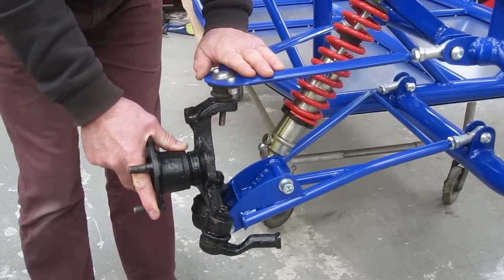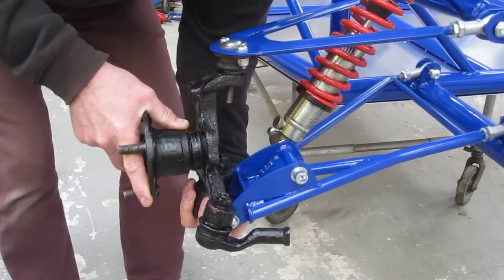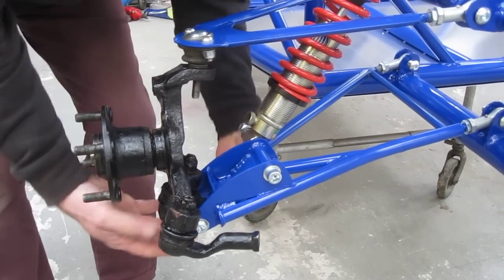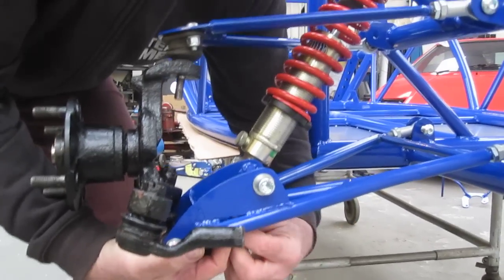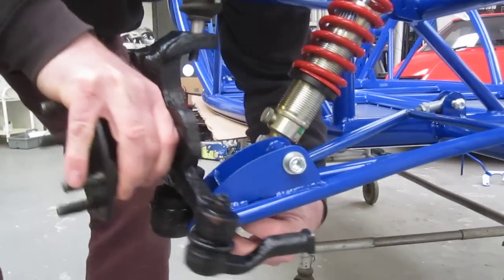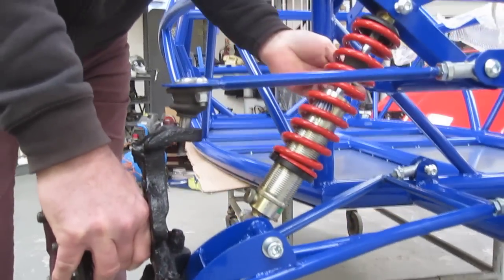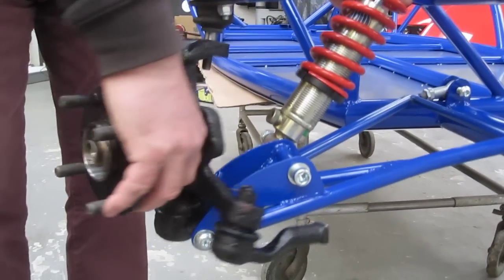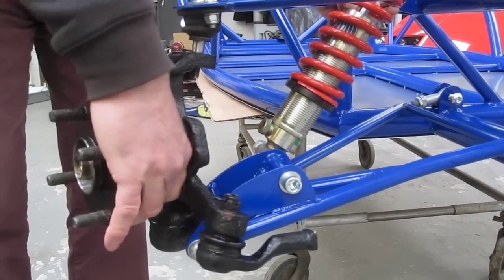In this particular car, it's quite easy to solve. All we've got to do is rotate the bottom ball joint assembly on the main pin. We'll put a couple of packing washers in the space there and bolt it up later. Just to prove the point, I'll put one washer in and load that into place like so. Then when we try to locate this wishbone at the top again into its proper place, it goes in without binding and we've got full travel there — left to right lock on the steering.